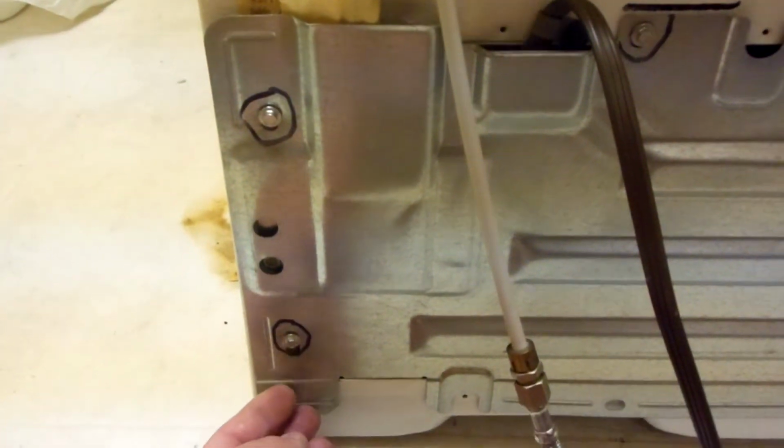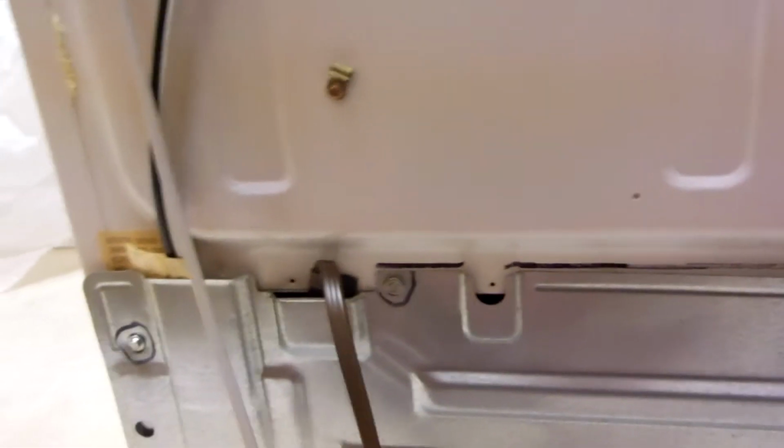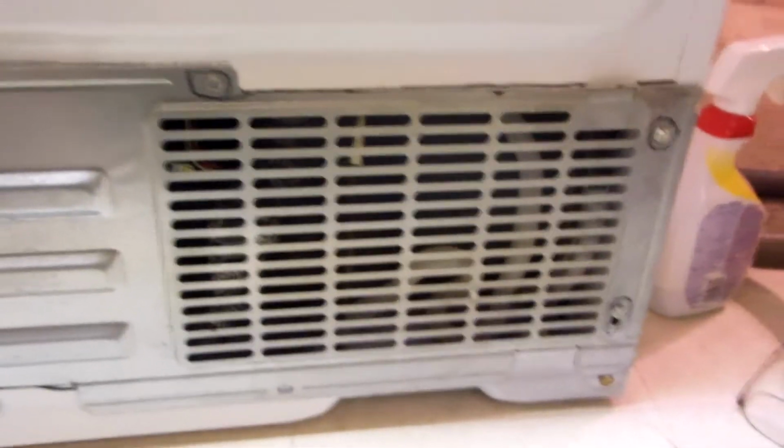Anyways, like I was saying, circle your screw holes, it makes it easier. Then you know where all your screws go back in. Makes things easier on reassembly. Like you'll see down here, there's another hole, and it never had a screw or anything. So just labeling things always makes reassembly easier. So that's it, I'm going to tighten it up, and I'm all done here.